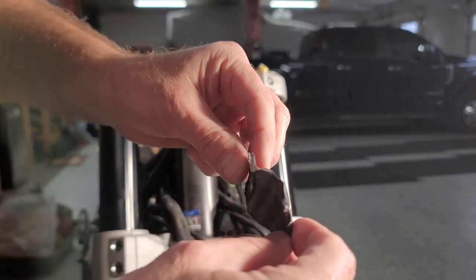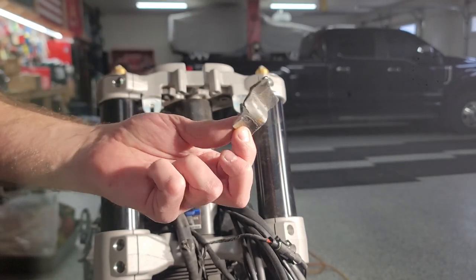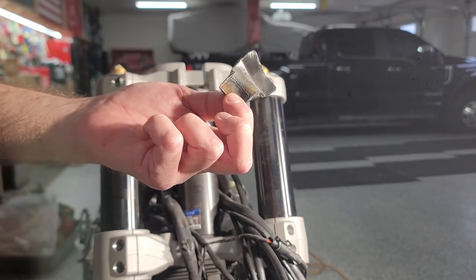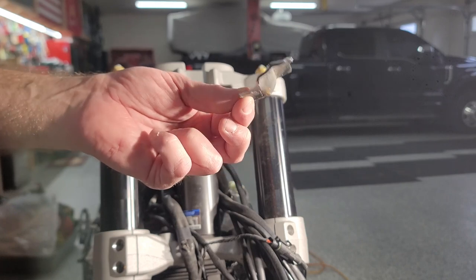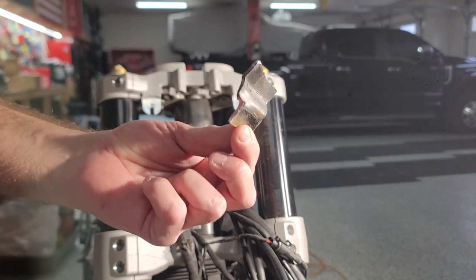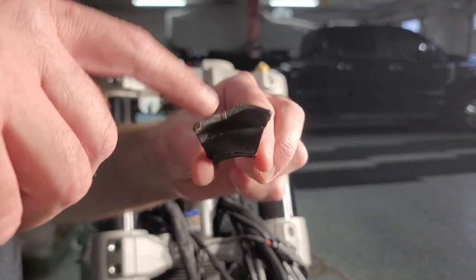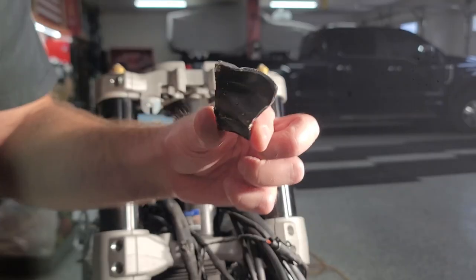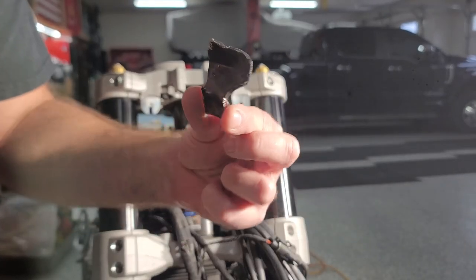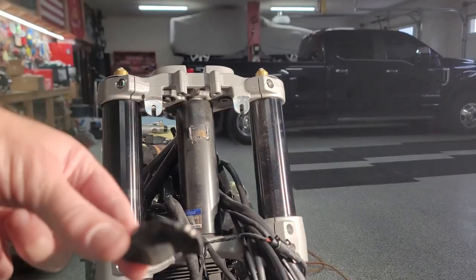So I'm gonna do my best to, oh, this thing is so weird. I'm gonna try my best to hammer it and get it into a Z shape, if you will. I'm gonna try and use a large socket, like a 26 millimeter socket, to have a curve and hammer it onto one of my impact sockets and see if I can get it. I'll probably try and heat it up a little bit too. That might help. So let's move the camera over to the vise area.